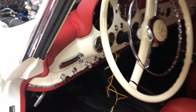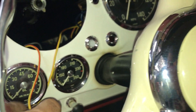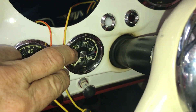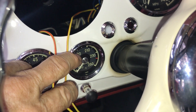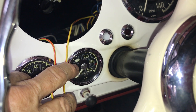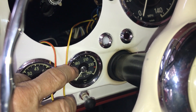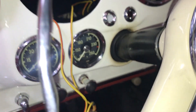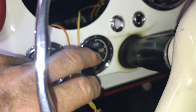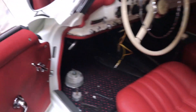Make sure you've got an accurate and functioning temperature gauge, because they are very good when they are working. We monitor ours at the 180°F range — yours you'll probably be reading in Celsius, so about 80 or 90°C. You need this to be accurate and working because it's going to help tell you how well the cooling system is being purged.